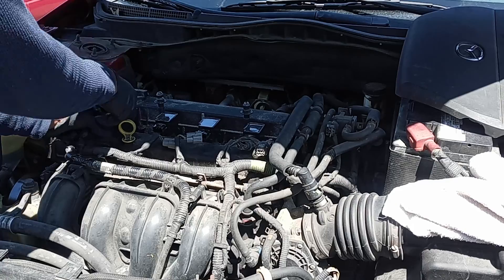All three of the other injectors have leveled out to 13.0. This first one is reading 12.8 — I'm gonna replace this one because it seems like it's malfunctioning, reading 12.8 while all the others are reading 13.0.